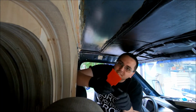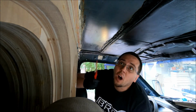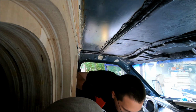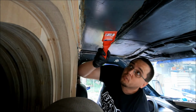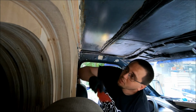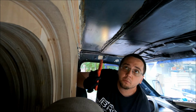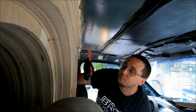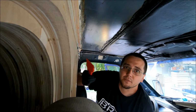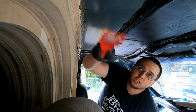Just a little backstory on this van. The reason why I got into selling Vibraflex was because of this van. I was trying to get this van ready for finals one year, 2017 it actually was. If you want to create a timeline, it's been about 3 years that this Vibraflex has been on this roof, and technically the adhesive has been failing for 3 years and it still hasn't completely fallen off. Again, the adhesive failed 100% because of poor installation, and like I showed you, the black to the yellowish grayish color.